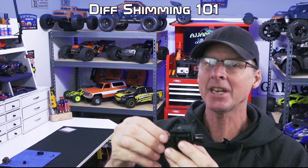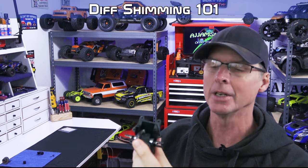Because once they're settled into place, they'll stay there because they settle into a comfortable position that they will keep. The upside and the downside to this is this doesn't get any direct pressure. What I mean by that is if the wheel was connected here and it bounced on the bearing, then that would shake things around a little bit and it would change how this rides, but it doesn't. It drives a dog bone. So this won't necessarily get shaken into place really fast because there's no lateral pressure on it other than the inertia of this bouncing up and down in the car.